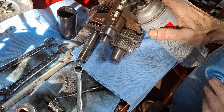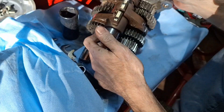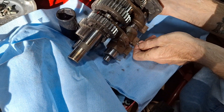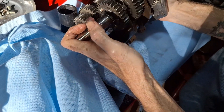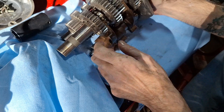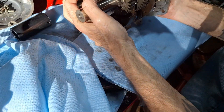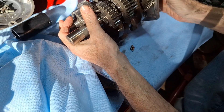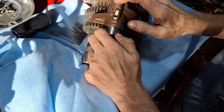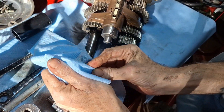Just spray a little cleaner on here. There's one little pin there. And one more — three pins out. We'll throw those in a bucket so we don't lose them. Feels like we've got some wear groove on the shift drum there. I've seen this before where the shift drum's cut — I'll show you in a minute.